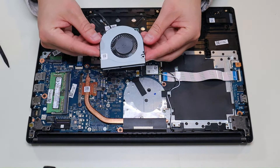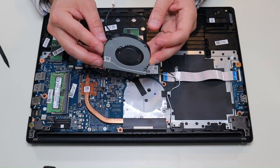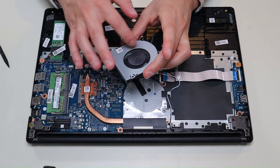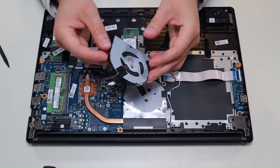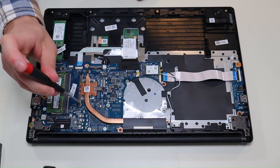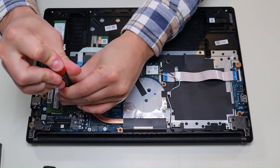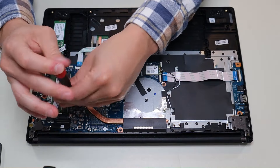That's your fan — I'll try to have a replacement fan option below in the description. If you're here because your computer is overheating or you want to clean it, you can now vacuum it out or blow it out really well. Your heat sink assembly is left here, so I'll go ahead and remove these three screws. If you're here to clean it, now you can fully access your fan — this computer is actually pretty clean.